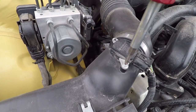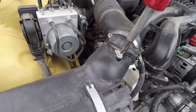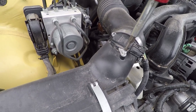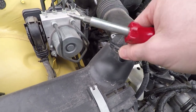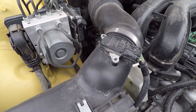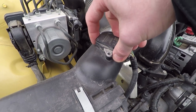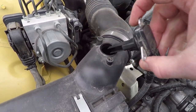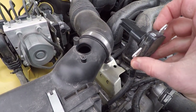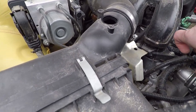The installation is pretty simple and straightforward. These two screws pull the sensor out. There's a clip on the side of the wiring harness — just unclip it. It makes it easier to move it out of the way and gives it more room. It will actually have to be unclipped with the echo block installed with the sensor because it lifts it a little bit higher up.